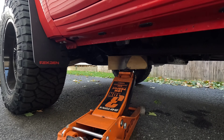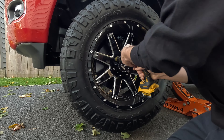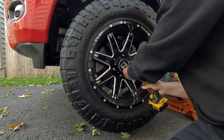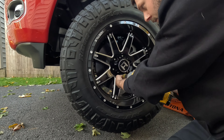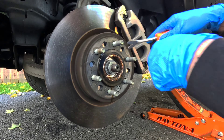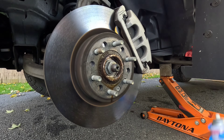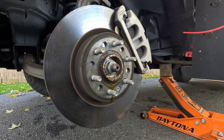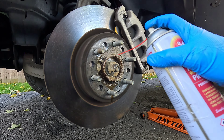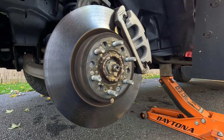Factory lugs are a 22 millimeter - I've got aftermarket lugs on there but the adapter is still 22. Let's get this hub centric ring off of here. Anytime I take a wheel off I always grab some fluid film and just fluid film this hub here - keeps things clean and rust free. Especially living up here in New York, things like to rust way too fast. So I like to squirt some on here and keep things as clean and protected as you can. Now we're going to take our spacer...